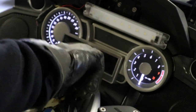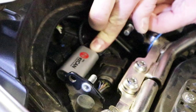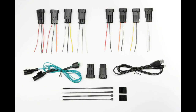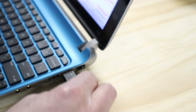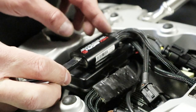Turn off the motorcycle's ignition switch. Access the main body of the EZ-Can. Remove the rubber plug covering the USB port and put the plug in a safe place. The EZ-Can installation kit includes a USB-A to micro-USB cable. Insert the USB-A end into a vacant USB port on your computer, and insert the micro-USB end into the EZ-Can.